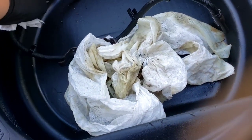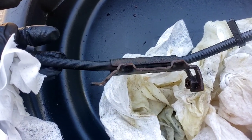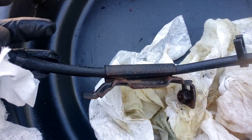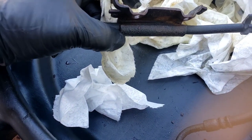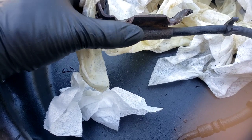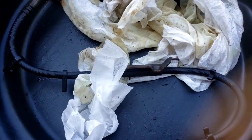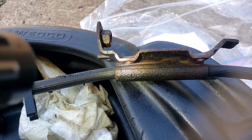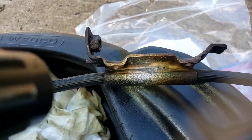I'm going to show you a closer look at what I'm talking about with the thing being pinched. If you look closely, you can see the hose is round, but when it goes through the bracket, you can see it starts to squash and squeeze out — it's got the same effect as if you were squeezing a straw. Let me get a flashlight — it'll be a little better. See how nice and round the hose is? It starts to get into this part of the bracket and starts to squeeze out.